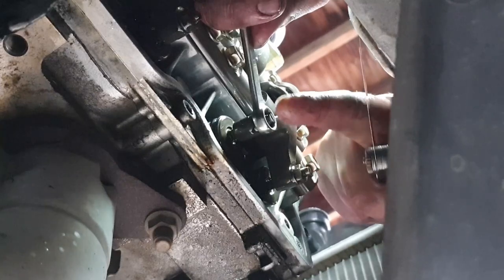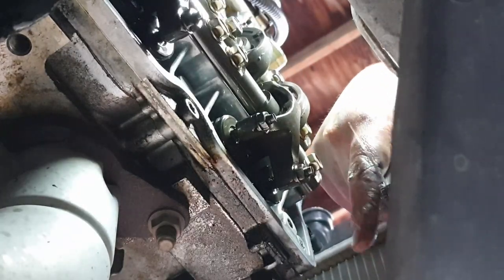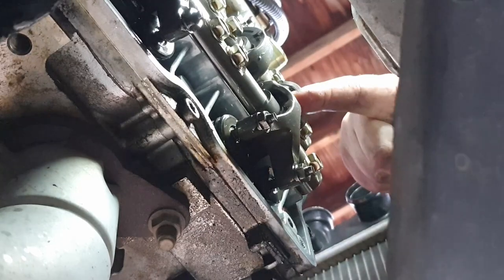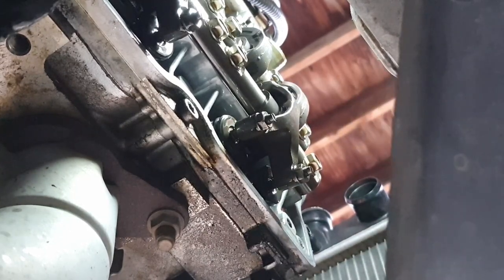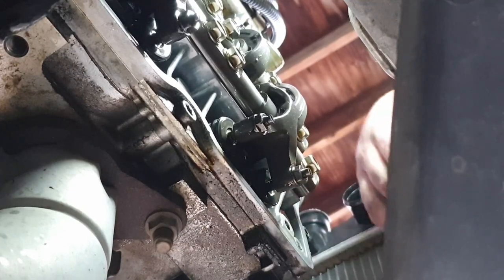I'm going to take that out, give the set nut a final torque, and these aluminum engines, it's really just somewhat tight, not forcing it too much. And though I don't know that these rocker arms are necessarily aluminum, I'm not sure what material that is. But in theory, our exhaust valve should now be set.